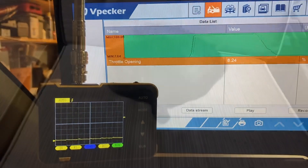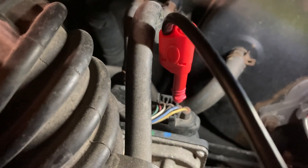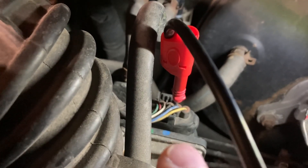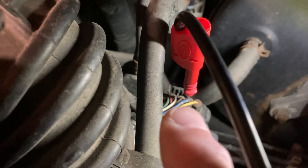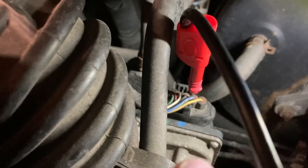Slowly opening again — look at the width of the pulse, the duty cycle. The average voltage being applied to the motor is low with a narrow duty cycle; a wider duty cycle when accelerating faster means higher average voltage, causing the motor to open not only more but at a higher rate. Then off. I'll now toggle to the closed windings — the blue wire — which is the closed side of the actuation drive.